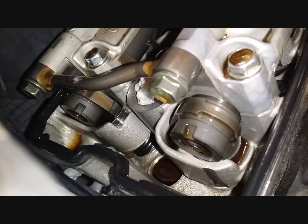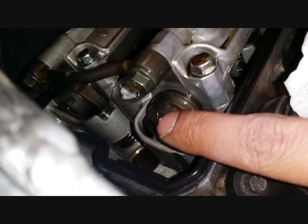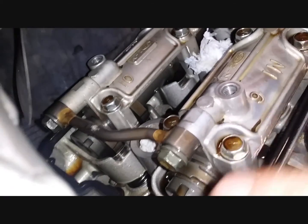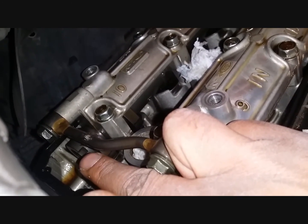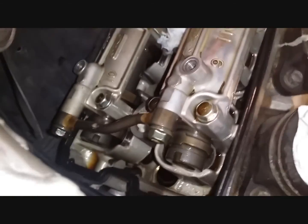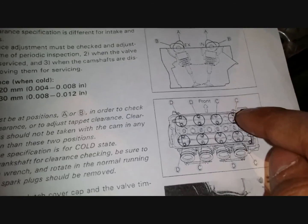So right now those two lines are aligned. As you can see, the intake cam has this notch perpendicular to the gasket face or surface of the head, and you've got the exhaust cam with this notch roughly 70 degrees again. So this matches, compare this to this piece of information which I showed you. Yes? So, with this setup, we can then grab our feeler gauge to measure the clearances on all the valves